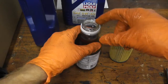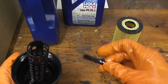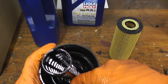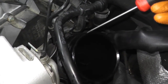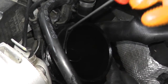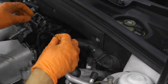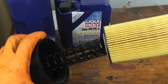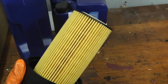Here's the new filter and new gaskets. Use clean engine oil to lube it up a little bit. Make sure the tab is facing up and install the new gasket. There's one more gasket that lives inside the housing — use a pick to remove it, then install the new gasket with some fresh oil. Add the new filter and snap it in place.